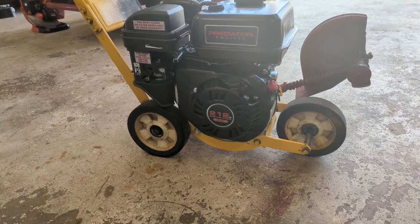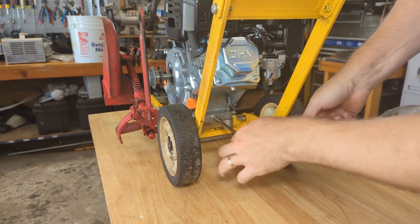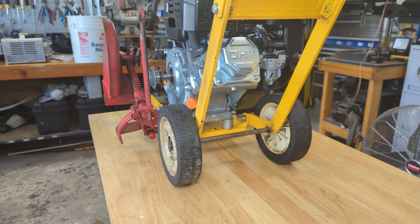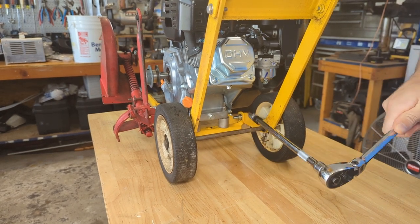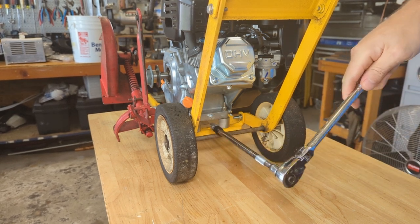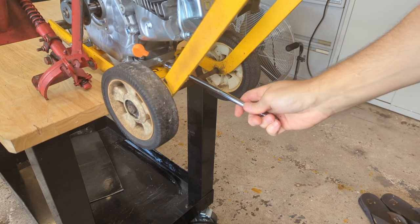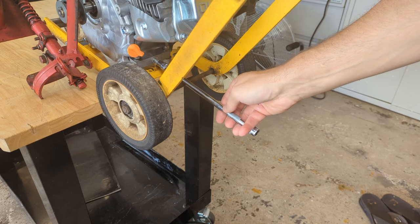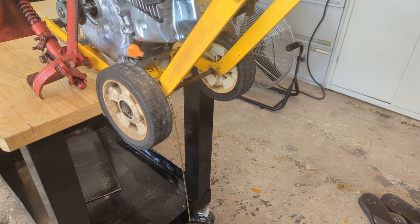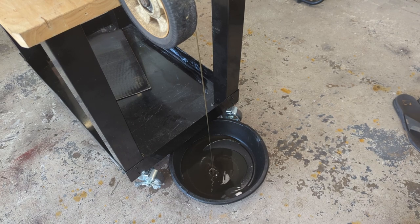Okay, just ran the gas out — ran it for a while. We're going to let it cool down and then we'll probably dump the oil. Looks cool enough. Use a 10-millimeter to loosen the oil drain plug — use our three-eighths ratchet. Got a drain pan on the floor. It was a little shiny, not tragically so.